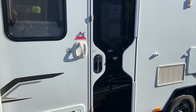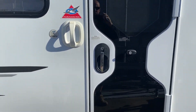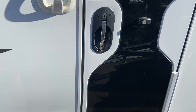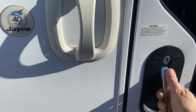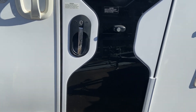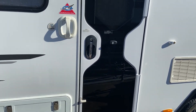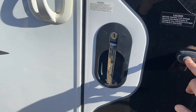This is a Dometic Seitz door. Parts for these doors are available through the Dometic company. The separation that these doors have only comes about by these latches here that hold it in — it doesn't have a full door separation like the other types do. There's not a lot of problems with these. There are other types of doors that do have this style of Seitz handle. Parts are available through Dometic, and pretty much the only trouble that we tend to have is with these magnetic latches that hold them apart.